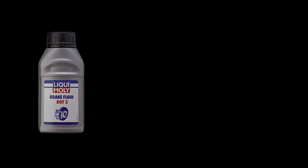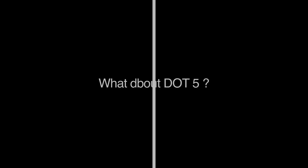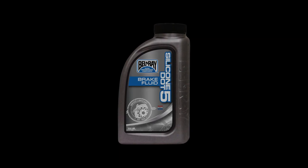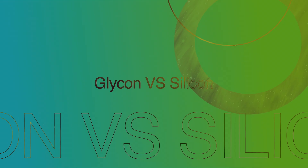With all these properties in mind, different brake fluids handle these situations in different ways. We have 4 different types of brake fluids, out of which DOT 3, DOT 4, and DOT 5.1 are glycol-based, and these three can be mixed together. DOT 5 is completely silicon-based and is a separate type of brake fluid which cannot be mixed with any of the others.